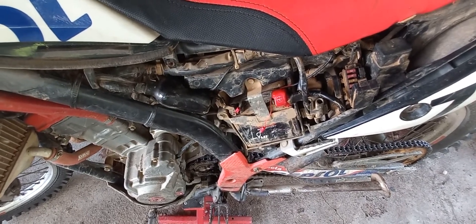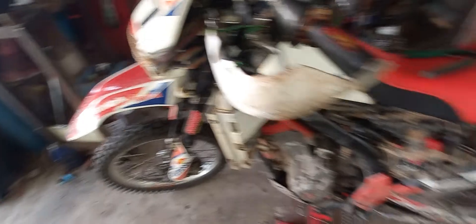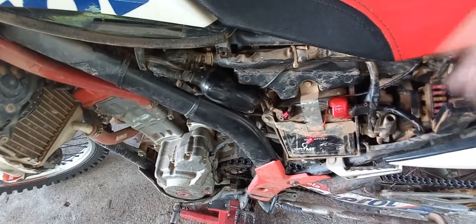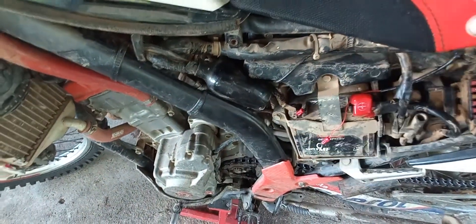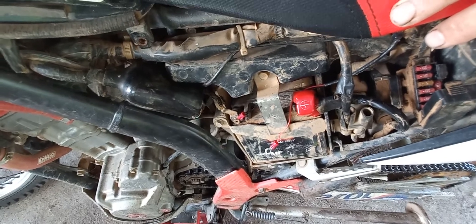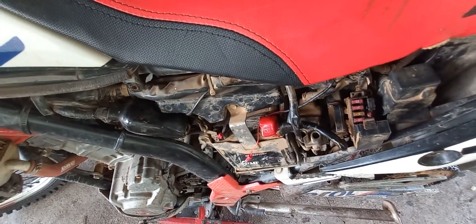Luckily 56 meters away was a trail. So I got down into the trail, got the bike to the end and had a good look at it and I could not find out what was going on. First off I did the corrosion on the terminals problem, which is where the battery terminals corrode on the inside. They don't go furry, they just go gray and that stops it charging properly. So I cleaned those up - didn't make any difference. Pushed the starter button, nothing happened.